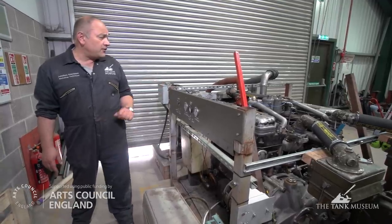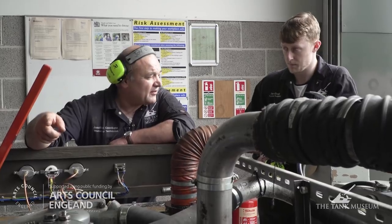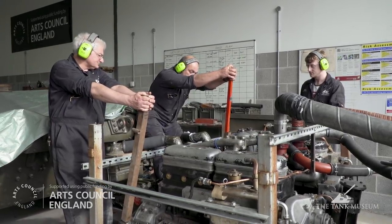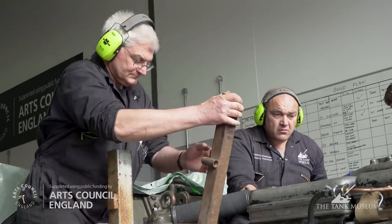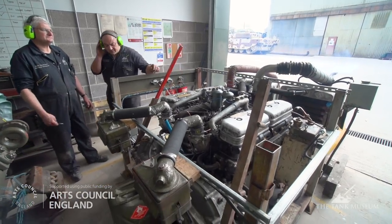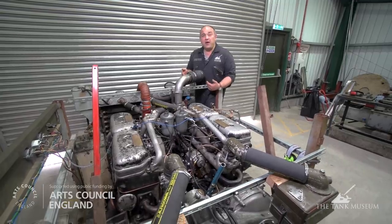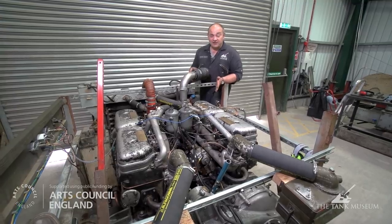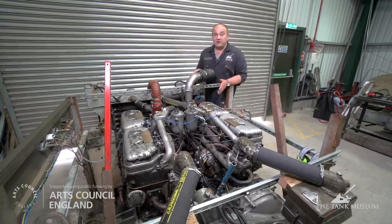You'll appreciate that we can rig a Kenlowe on the radiators; however we don't have the engine fans fitted because they're mounted on the gearbox. The test we were carrying out today was a test on the clutches to make sure each engine can be started independently and one engine would start off the other, and once we disengage or engage the clutch — which is an important feature of this engine design. Having tested both engines individually, put them together, built this test stand, synchronized them as a pair, fitted the cross drive and checked the clutches to make sure they engage and disengage and start one engine from the other — now all that remains is to get this engine in the tank with the transmission, the air system, the steering and get all of it to talk to each other. Sounds simple, but we've still got a way to go.